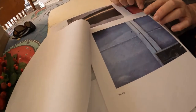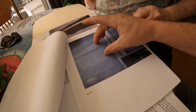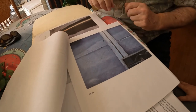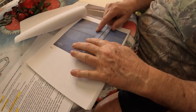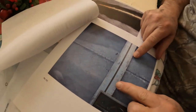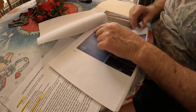Gel coat back. So this is where the body comes together. Hey, this is where the seam is, right along here. And where Factory 5 puts the glue in it. They're cutting the seam down plus the gel coat to expose it, about 2 inches wide. Okay. And then this is the seam that you've got to take out.